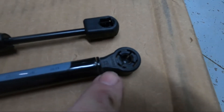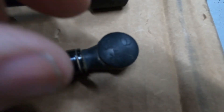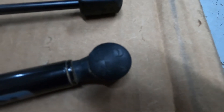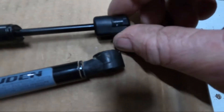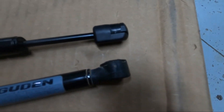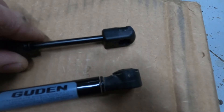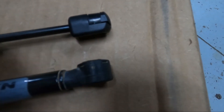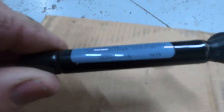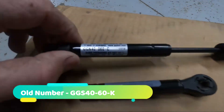Here's the old trunnion on the end and here's the new one. The old one had a part in the center that you have to slide out — you get a screwdriver behind it and slide it out to pop it off the trunnion ball. The new one just has a spring band on it; you put a screwdriver in the slot and pry it out to release it. It doesn't come with the new ball, but if your old ball is broken you can buy the balls separately. You don't need to take them off — just pull this off and pop it off the ball.